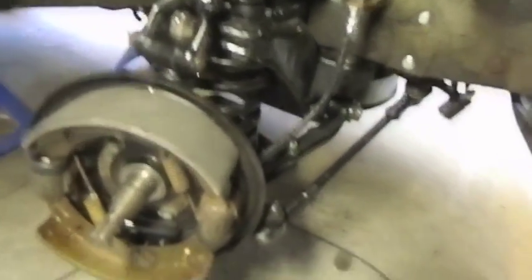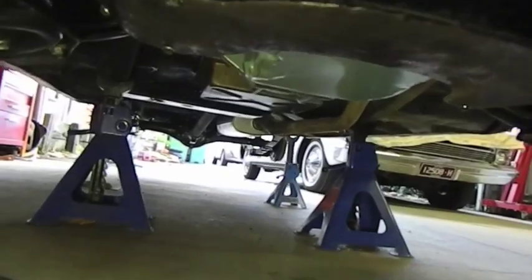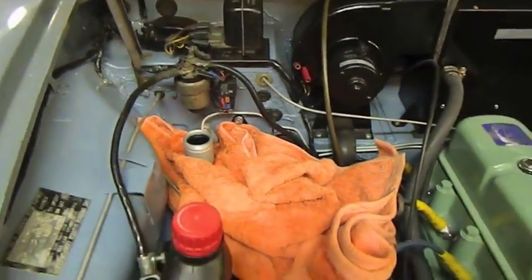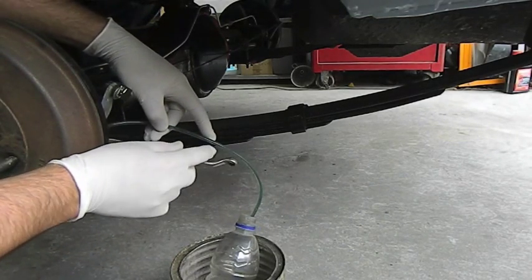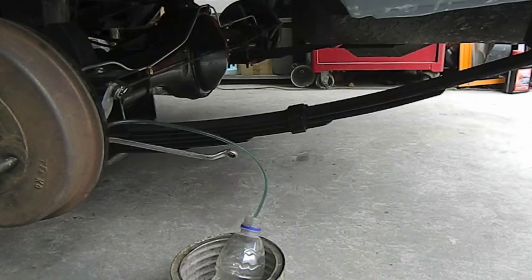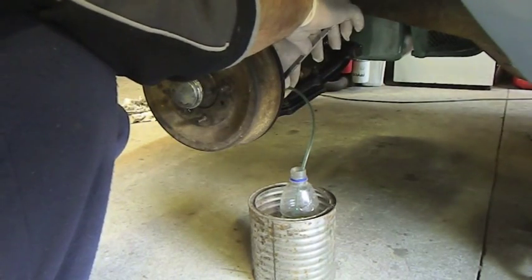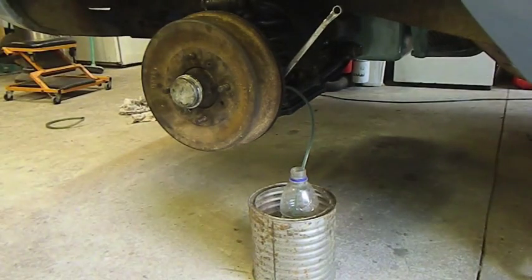The front end's all together. Kingpin's done, all the new lines, mounting hardware, new shoes, wheel cylinders, all the rest of it. Looking underneath, the front end's been re-bushed - it's all looking pretty good under there. Looking further rearward: new exhaust system, new brake lines, rear axle's in too. Now it's time to bleed the brakes. Just up and down, very slowly down. I'm going to lock this off. Now push down, hold it down. I'm going to go and get the air out of every corner and then do a final bleed. Pump it up, hold it down. How's the pedal? Looks good. Is it staying up high? Very high.